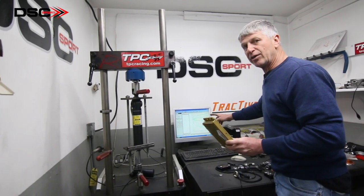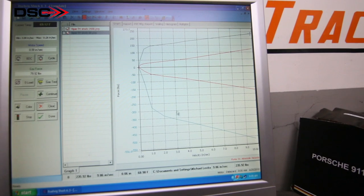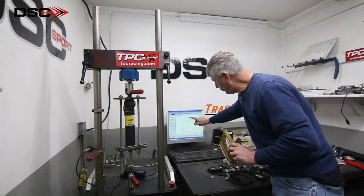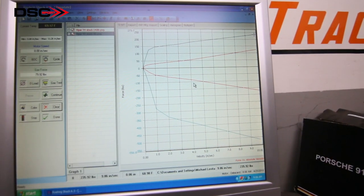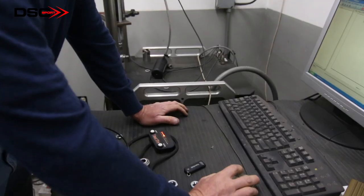Everything from drag racing to road racing to autocross can all be achieved through the algorithm of the DSC. What you're looking at right here are two different distinct patterns: a touring range and a sport range. These can be controlled through the DSC as to when they come in and how they're combined in the control strategy, simply by going into the shock calibration table and adding those.